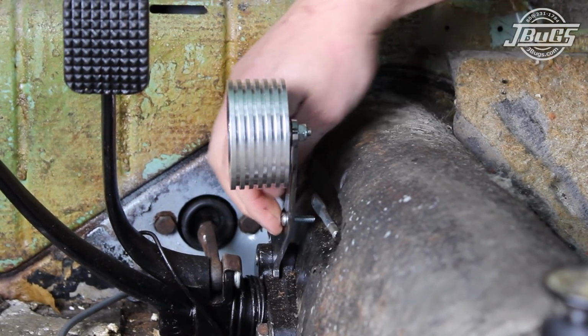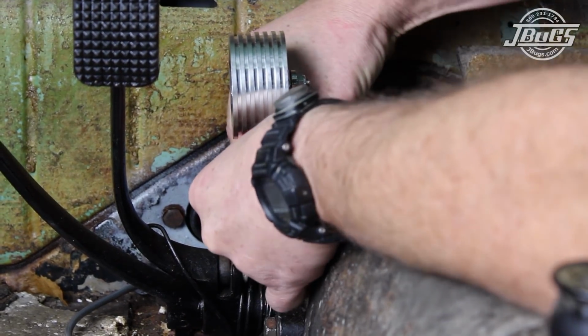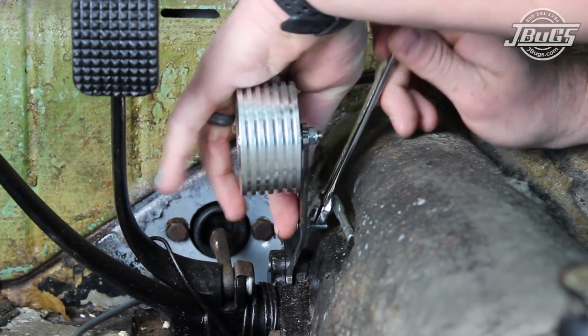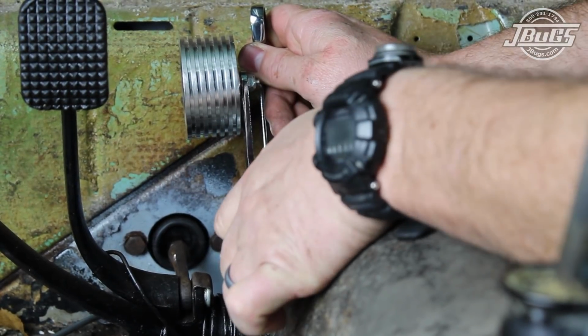The accelerator cable can now be hooked up to the pedal. We now have a roller pedal and a heavy-duty cable which require a small bolt and a few nuts to hold the cable in place. If using a stock pedal and cable, attach the cable to the pushrod on earlier models or through the pedal lever on late models, and the job is done.